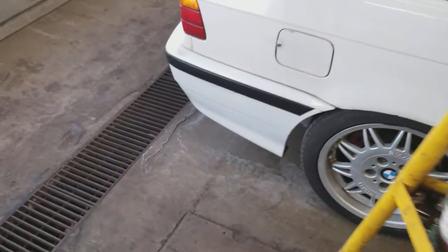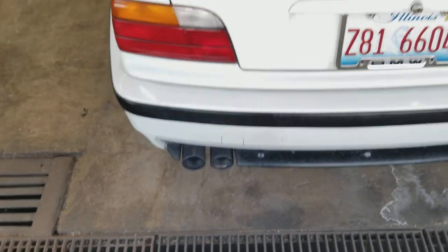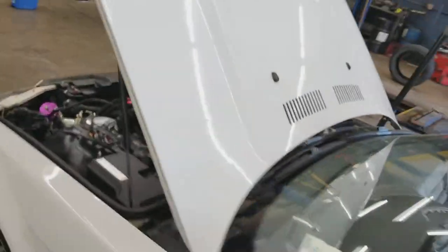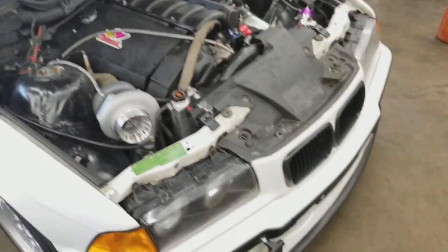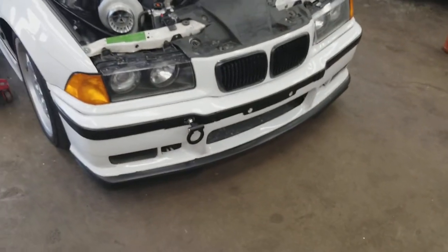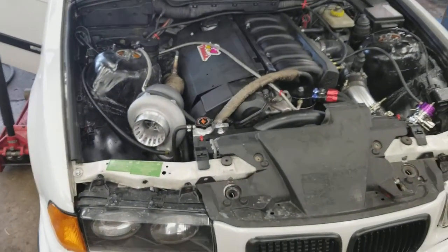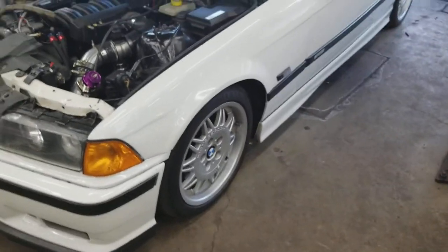It has a custom exhaust which I made here at the shop at Des Plaines Auto Clinic. For those of you turbocharging your car with the Miller Performance Tune, you have to delete your EWS system. The car will start, but it will take at least 30 tries. If you delete your EWS, the car will start right away. I was dealing with Brody — he guided me on how to bypass it. It's actually pretty easy: you pull off the glove box, disconnect the EWS system, and the car fires right up. It's a security system — I couldn't believe a 1995 car came with that system.